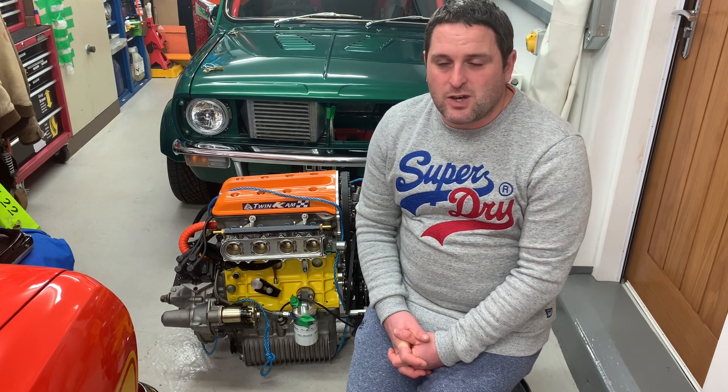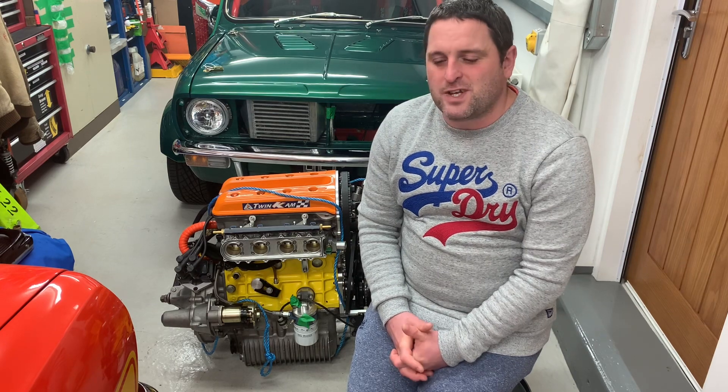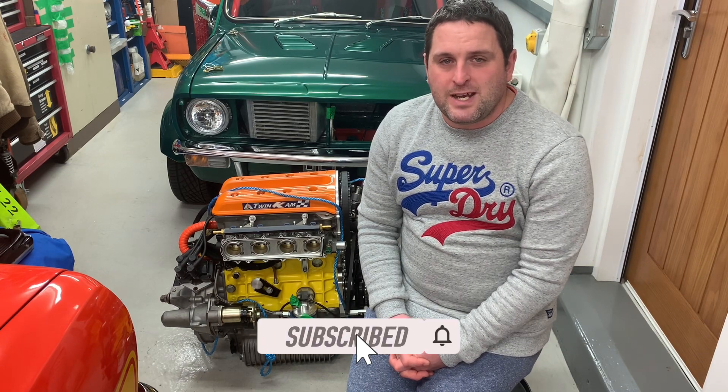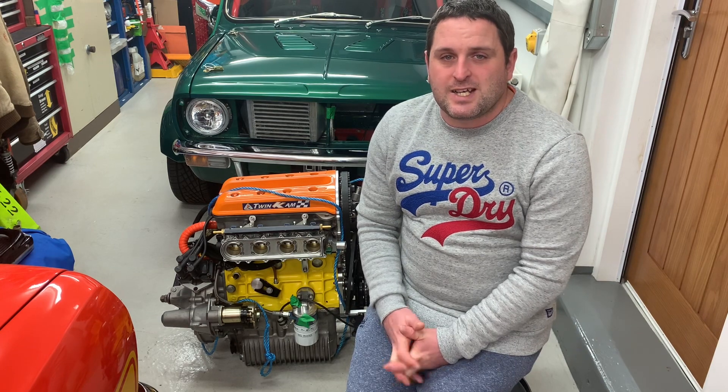Well guys, I'm going to leave that episode here. I'm sure you'll agree that's a massive improvement on how it was before. I've done a bit of research around the silicone hose on the 90 to make sure it's capable of withstanding oil, and it would seem that it definitely is — and to be honest the original Metro Turbo had a silicone 90, so I'm fairly confident it should be fine. The next episode we're probably going to mainly focus on the turbo actuator bracketry and how we're going to improve that. It won't be far away because I've pretty much got all the footage together already. Thanks very much for watching and I'll see you very shortly.